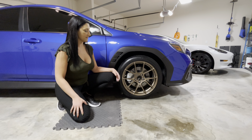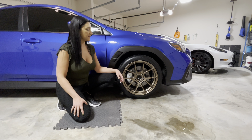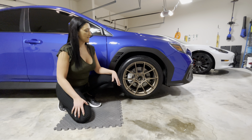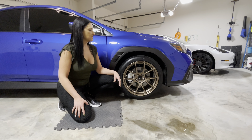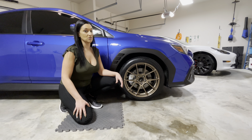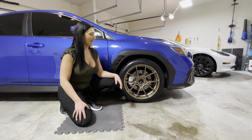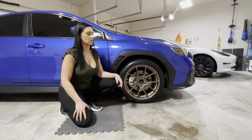I like the darker colors, and I decided to go with 18s by 8.5 because for performance reasons, I wanted it to be a lot lighter. These should be a lot lighter than the stock wheel and tire. I decided to weigh the stock setup, and it was 51.8 pounds — almost 52 pounds — so pretty heavy for each wheel setup. I haven't had a chance yet to weigh this new setup, but when I do, I will put it in the description for you.